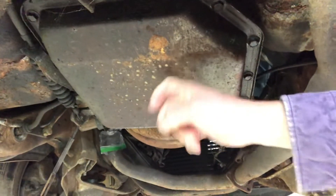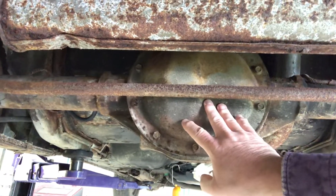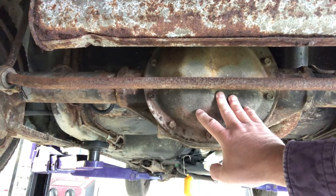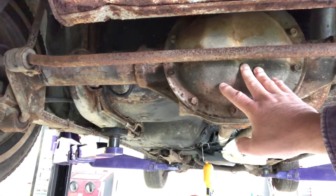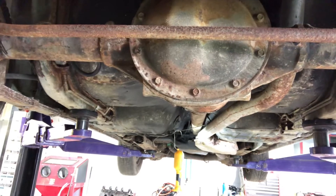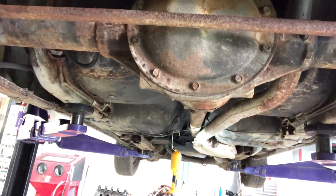That was just kind of a common thing to do back then. I still have to take the transmission out — just getting back to working on it. I'm going to pull the gas tank out and clean up some things, take the rear end out. I want to put different gears in it. This being a base formula with a 350 2-barrel that came with 2.41 gears — yeah, they're going to go. I'll put something probably not too crazy unless I go with an automatic overdrive transmission, which I haven't decided yet. If I do that, I might put something wilder in there like 3.73s. If not, probably a 3.23 gear. I run that in my Mopar — they're good all-around street gears. You can still cruise on the highway and you still got a little oomph as long as you got the torque for it.